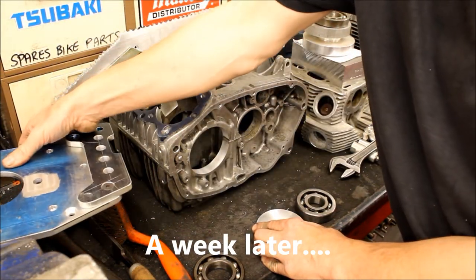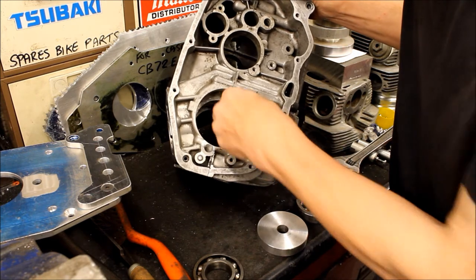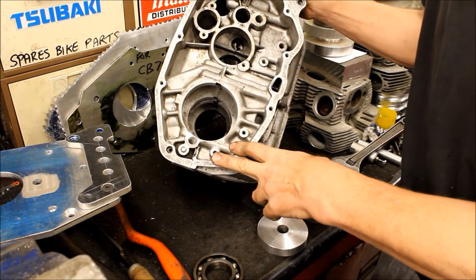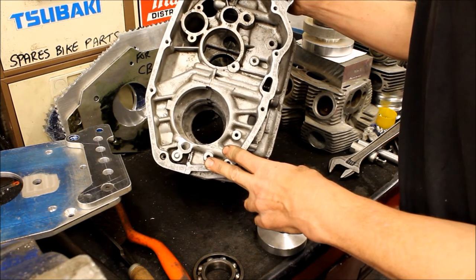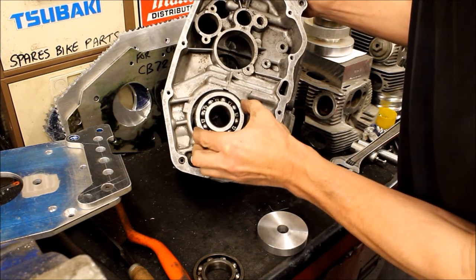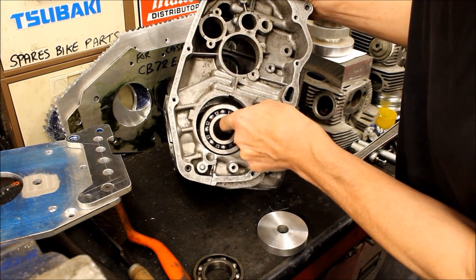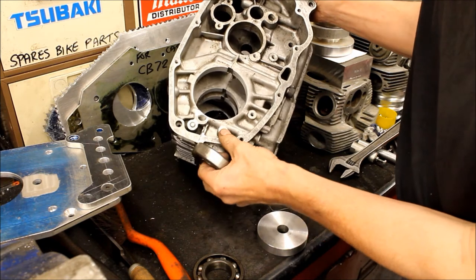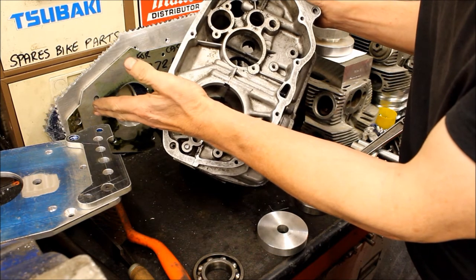So Jeff, you've been busy this last week — what have you been up to with your Honda? The two centre main caps of the crank cases have been bored out, so they will now take a 500 Honda T main bearing — a lot stronger hopefully. The others are smaller so we'll have to make some sleeves up. We've moved the bearing position 4.5 millimetres forward, so the whole point is moving the centreline of the crank 4.5 mil forward so it lines up smack in the middle of your studs so you can increase the bore size.